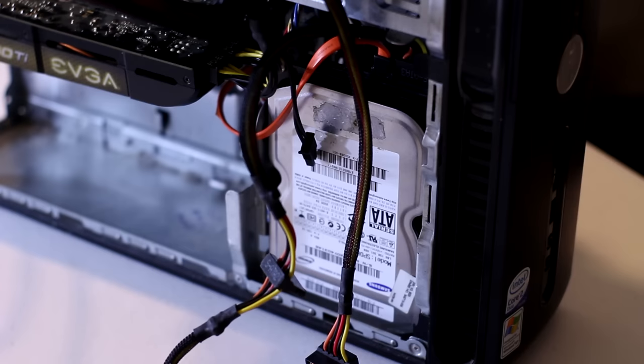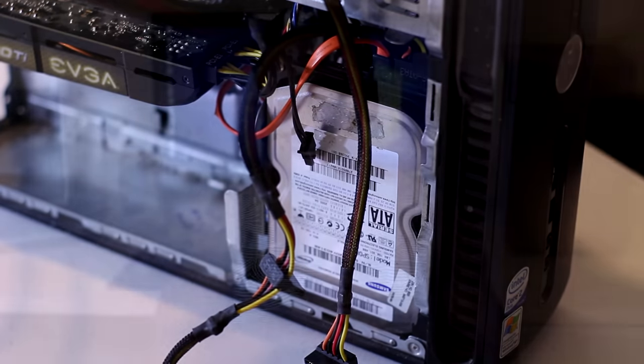If you are gonna go for an ultra cheap gaming PC, and I doubt any of you will really try to build a PC for $25, it's not very conventional, but if you do decide to build a super cheap PC, definitely try to get at least a quad core processor or a dual core with hyper threading, because as you can see, pretty much any game 2013 plus, with the exceptions of a few indie titles, will use more than two cores, and you will be bottlenecked if you have less than four cores. So try to go for more cores if you can, and if you do end up with a dual core PC, try to overclock.